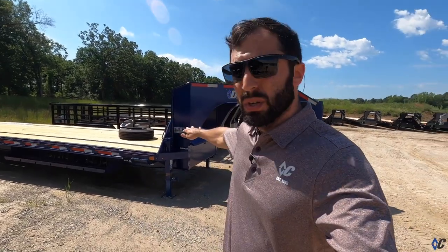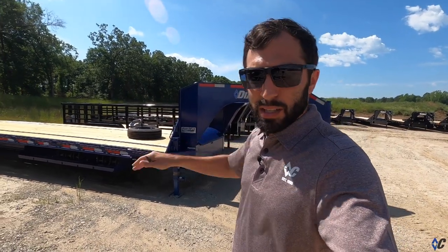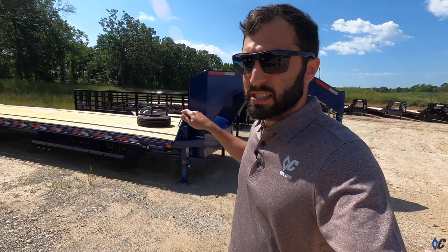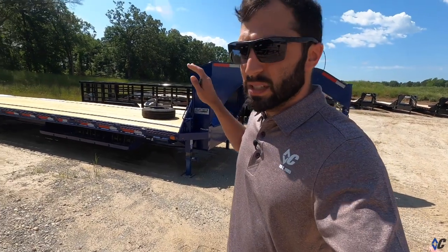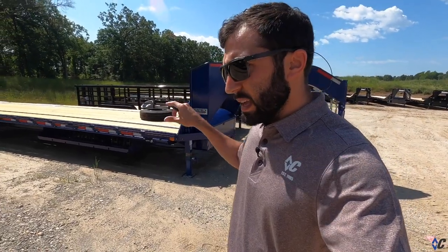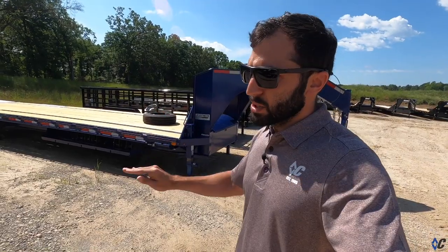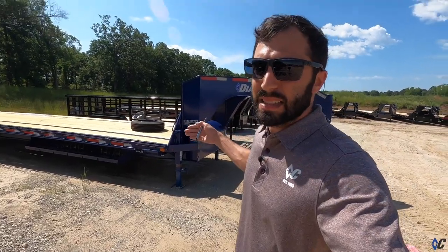And what's right here, this blue one, is a FMAX 208. I don't know the customer personally, but the way this one was built, I can imagine he went online, had a specific job he's doing. He is hotshotting, maybe lots of partials, sometimes single, more concentrated loads. But the 208's a great trailer for that because it's got the 8K axles under it, which have bigger brakes than 7Ks, but it keeps a single tire. It's kind of the best of both worlds. Weight-wise, it lands between that 210 and that 207, so it's not eating up a lot of your available payload while being rated at 18,000 GVWR.